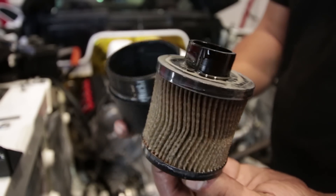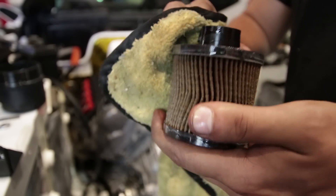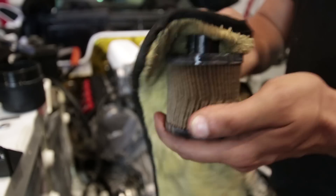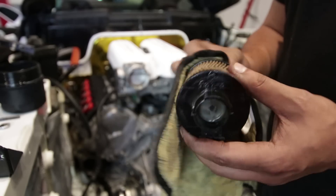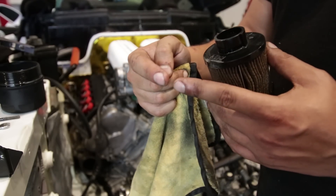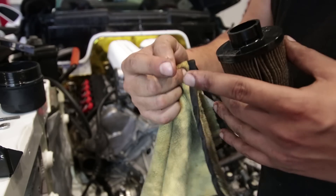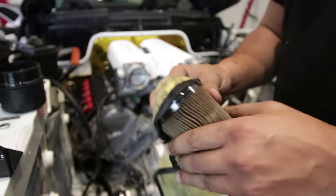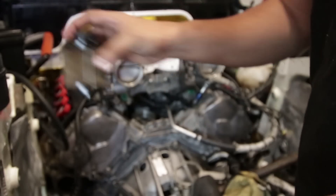You can see the cartridge and there's more of that milky substance where the gas and oil just met with moisture. It's not that gas is directly in the oil, because that would indicate piston ring failure. On engines with a lot of boost and power, they tend to gap the piston rings a little more, because when boost hits, the rings close up with heat inside the cylinder. This engine might be toast — I don't think so, I really hope not. It sounded healthy and didn't exhibit any nasty smoke other than what comes from running rich, so I don't think I have to worry about that.